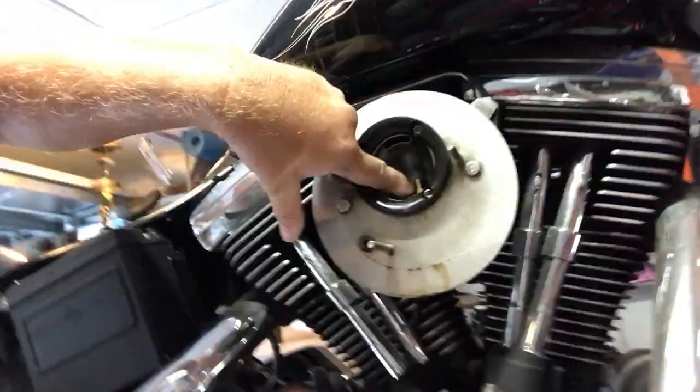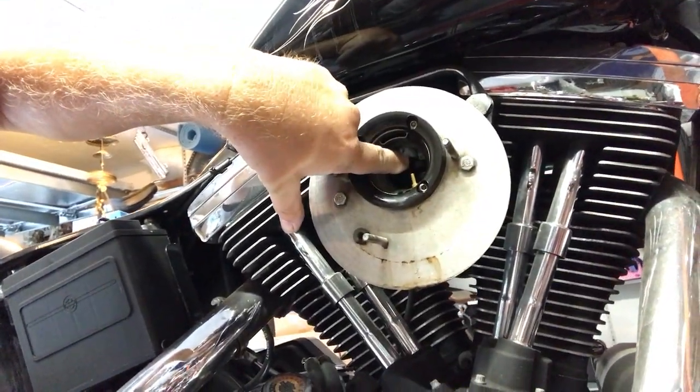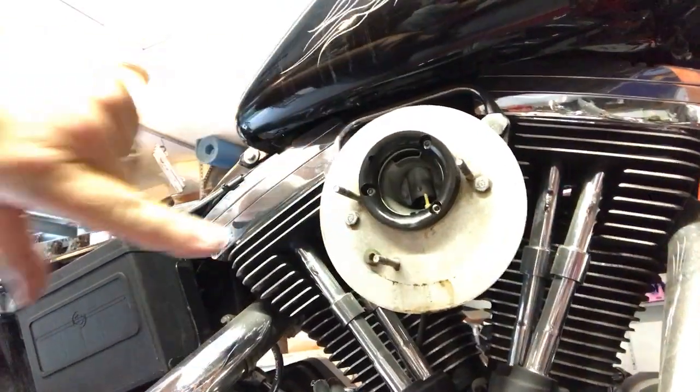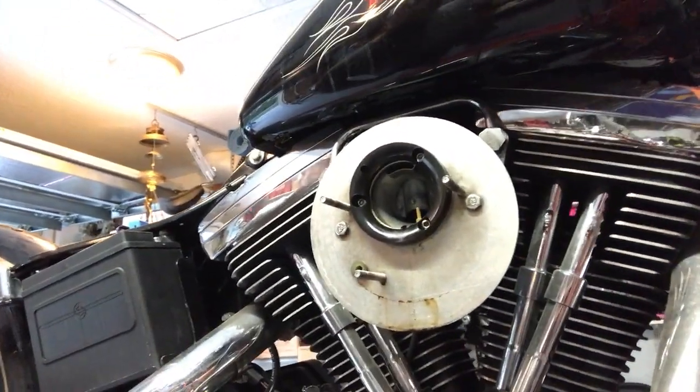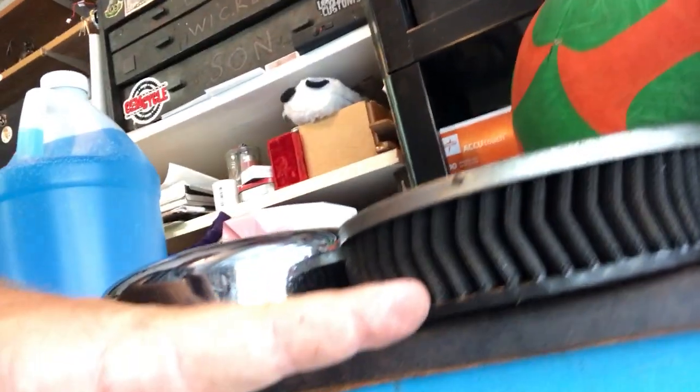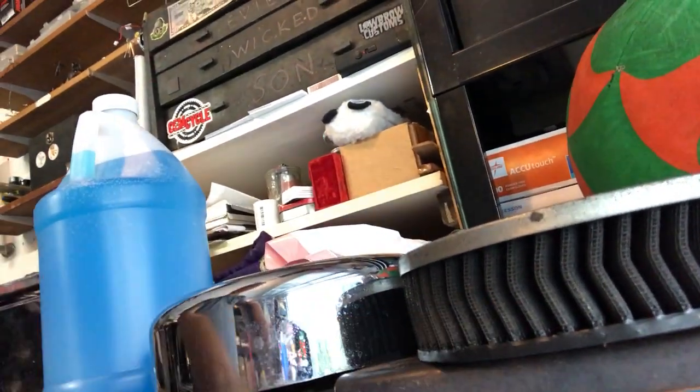When I first started, the slide in here was stuck. The carburetor looks fairly clean from the outside and throat and whatnot. The filter was a little bit dark — it needs to be cleaned. She's a little dark, needs to be cleaned out; heavily oiled, I'd say.